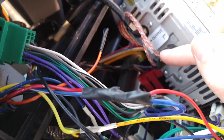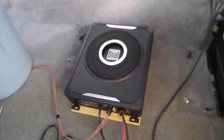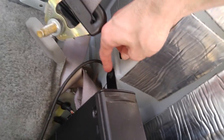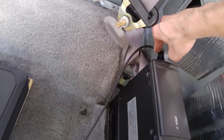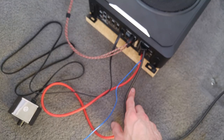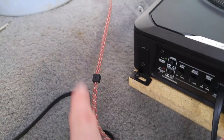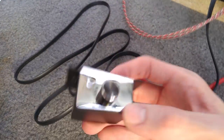Route the RCA output cables and the turn-on wire along the opposite side of the vehicle from the power cable. My power cable runs along the driver's side dashboard all the way to the back. Under the seat, I have the negative hooked up to bare metal — to get a good bare-metal connection, file or scrape away the paint. I have the positive running from this side of the vehicle, and the RCA cables run from the radio on the opposite side. This is the remote control, which lets you adjust from min to max.